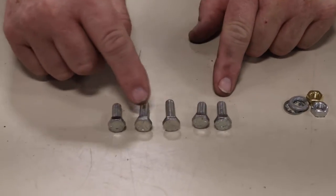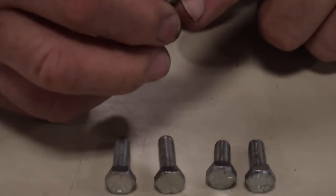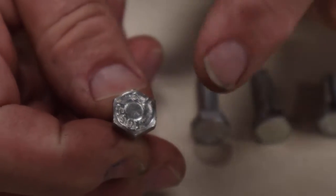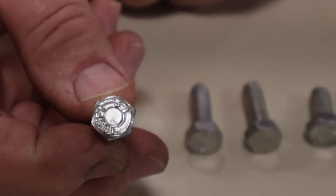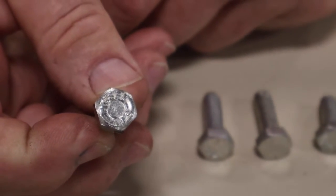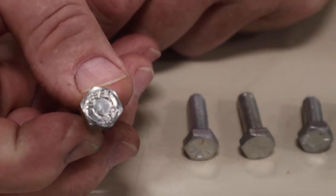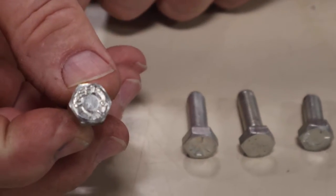These have all been replated — one of them is brand new. This one has a circle with three hash marks on the outside, so that means it's a British manufactured bolt. There's a series of letters on the top that might say GSK or GKN. Some of the earlier bolts said Linread — L-I-N-R-E-A-D — that's the name of the manufacturer.